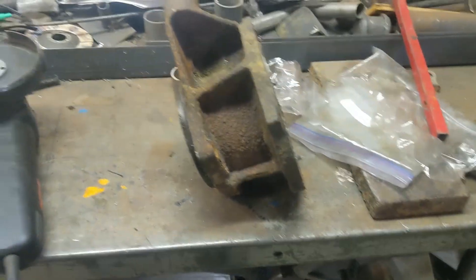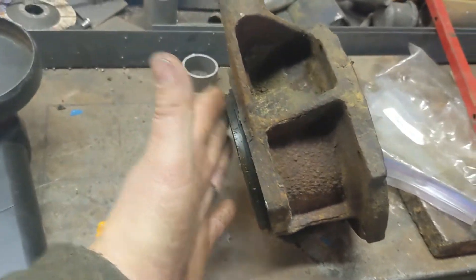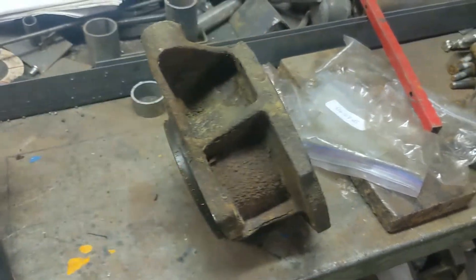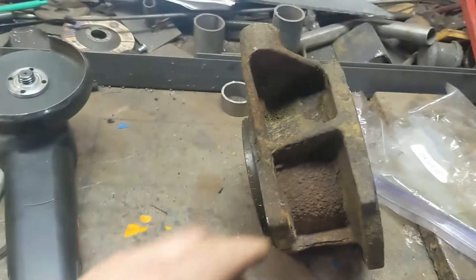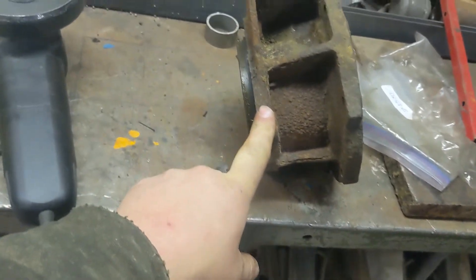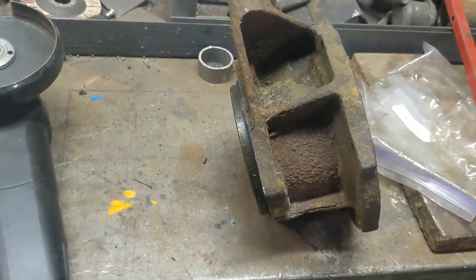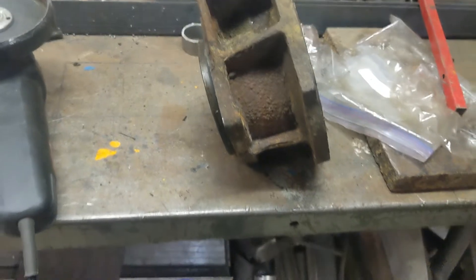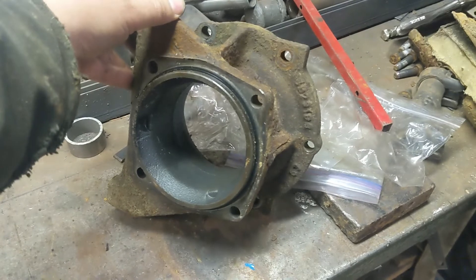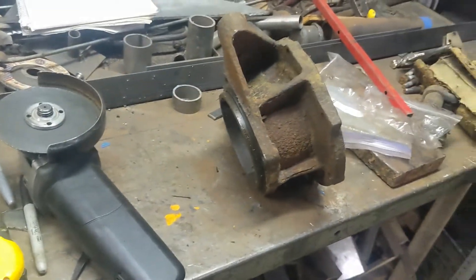The reason we have to cut this up — this is about three and a half inches. The output shaft on the Turbo 350 isn't sticking out at all; it's actually recessed behind this surface. So we can't have this big space between the two. We have to shorten that up. We're going to cut this surface off, squish it together, and weld those two back together. I have no idea if it's going to work, but we're going to try it. This is an old crappy rusty one — it's perfect for what we're doing. I have two others, so we're not hurting anything we don't already have spares of.